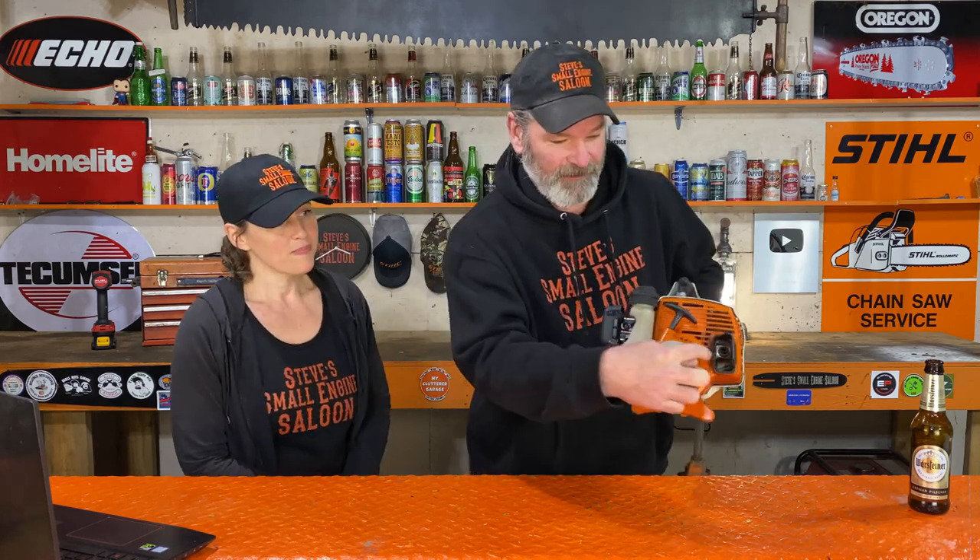Right in the muffler, people will see black goo and stuff draining out of where the muffler, where the exhaust comes out, and it makes a mess all over. The reason for that is because maybe you have flooded your engine at some point. When you flood your engine, it's getting gasoline — your gas-oil mixture — into the bottom of the crankcase down here.